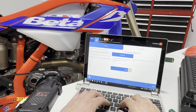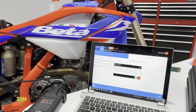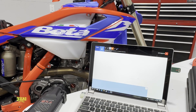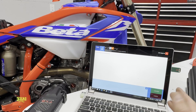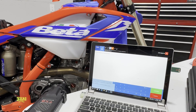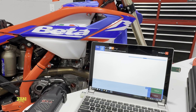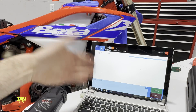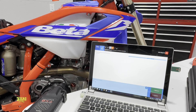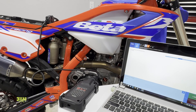I have to enter a dealer password here. The battery is fully charged, we're good to go. They want these bikes on a battery maintainer. I think right now it's deleting the ECU. I've only done this a couple times because Beta made us buy into this TEXA program — before it was just a different Beta tool. Current date is 3/31 — it's Easter, so happy Easter everybody. It actually had the right date. This takes a minute — down in the corner it's at 4% done, and we'll let it go to 100%, confirm, and then we can take the bike outside.